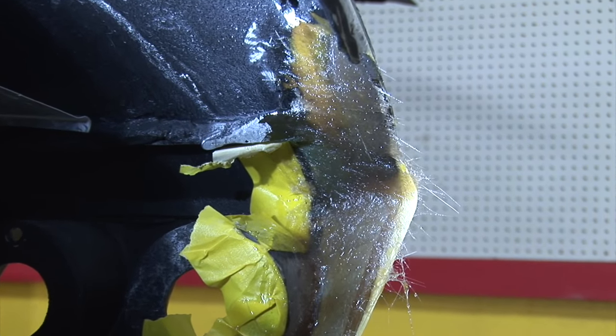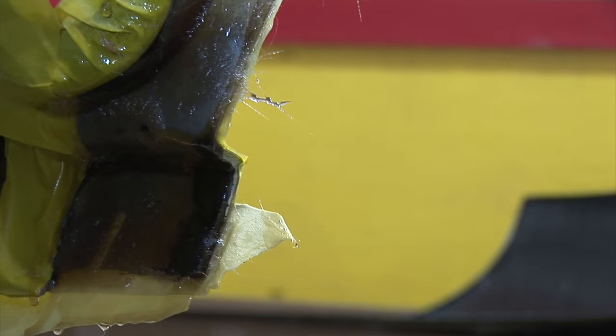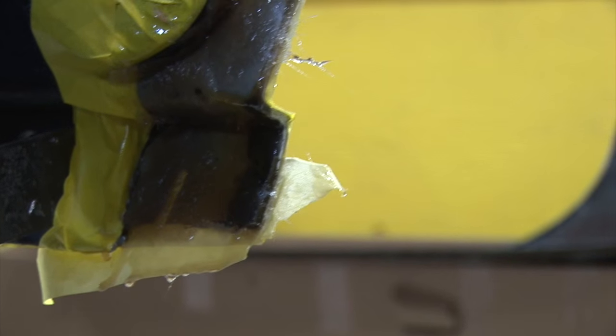All right, all those little pieces that I had cut up in strips, I've applied up in here and resined and rolled all out with a tooth roller to compress it. The trick is trying to retain as much cloth and fabric in the fiberglass repair and the least amount of resin. So I'll lay it all out and then I'll roll it. I got little tiny rollers and I'll, let's see.